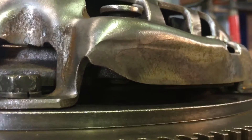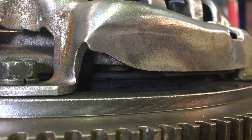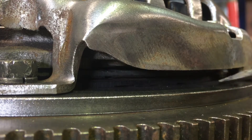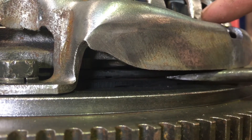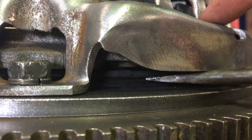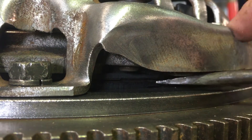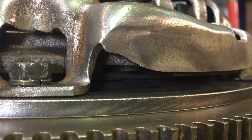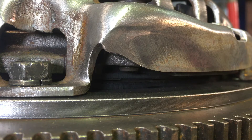I'll see if I can actually spin this thing by hand, so you can see it moving internally. I'll press down on the clutch, which releases the pad — so now the pad should be free to turn. You can see the actual clutch pad itself is free. When we release the pedal, it applies pressure and it's no longer free — it's actually stiff. It makes it all one piece, and that's normally how people drive your car, because it's all one piece, driving it from the flywheel, through your clutch pad, through the gearbox shaft.